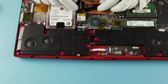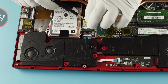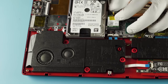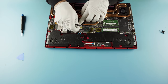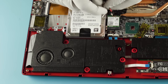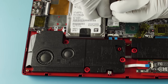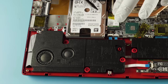And if you want to change out your Wi-Fi card — put a killer Wi-Fi in here or whatever you feel like doing — it's pretty easy. Just remove those antenna leads, get them out of the way, lift this guy up, one little screw keeps it in place, and pull it out. Like the standard for pretty much any laptop, it goes in at a 30–45 degree angle and then sits down. And the fun part, of course, is putting back on these Wi-Fi leads. Cables don't want to work with you — this is already a pain for anybody who's done this before. It doesn't matter how many times you do it, it's always a pain. You need to make sure it just covers those little metal pieces there, and we're good to go.